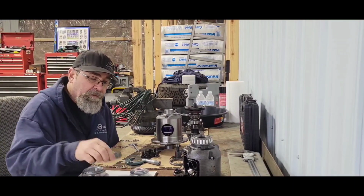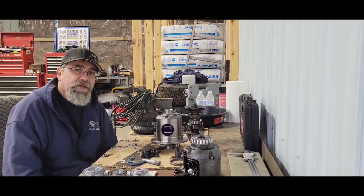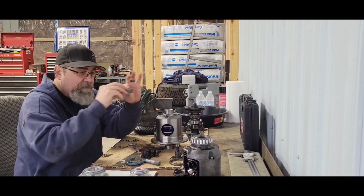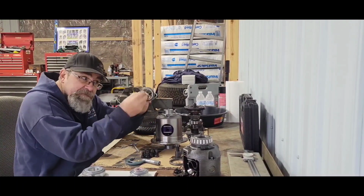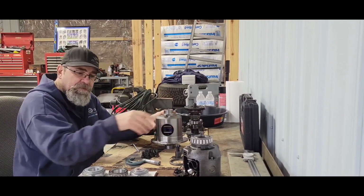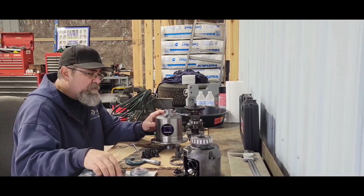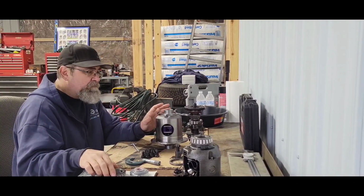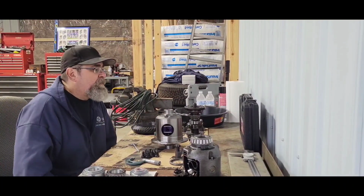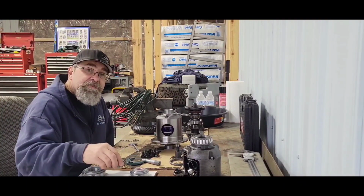That's pretty heavy for that small of a bearing, but I'm hearing that this Carrier brand likes a pretty heavy press, and you don't want these spinning. You don't ever want these inner races spinning because nothing retains these but the press. So I'm cool with that. So I'm gonna go ahead and throw this in the freezer, and these are gonna go in the oven at about 350, and I'll measure everything before I go to assemble it. I like to see about 1 thou clearance, and they should fall right back on there. So actually a little bit more than 1, but we'll see what happens.